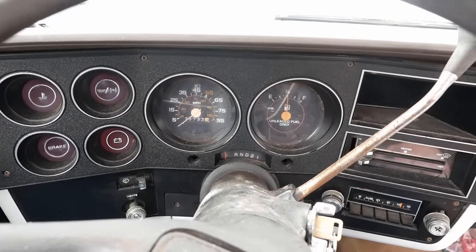Well, this might be the easiest wiring repair you've ever seen on this channel. So it's got a T in the harness for the tail lights to add a 4-pin trailer connector, and it just came unplugged on one side. So let's plug that back in, see if it solves our problems. That'd be pretty sweet if it did. Well, look at that.